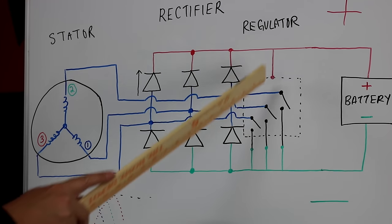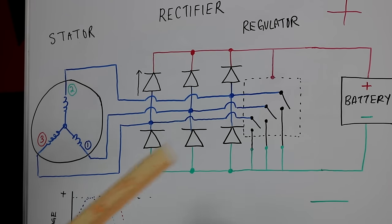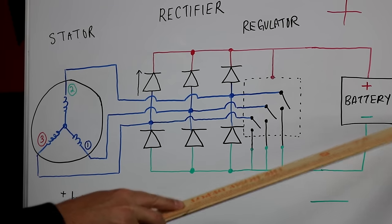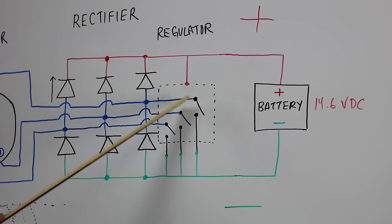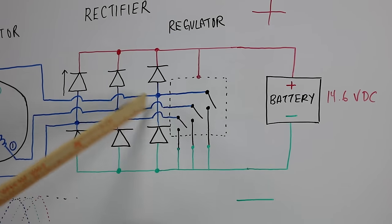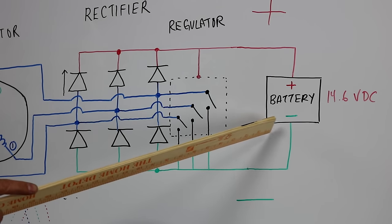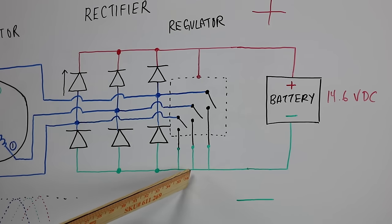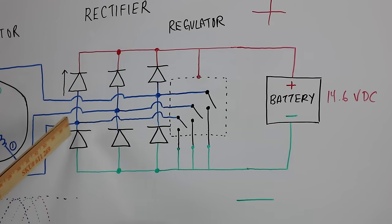The regulator is a separate piece of electronics on the circuit board inside that monitors battery voltage. When the battery voltage goes higher than the regulation point — generally 14.6 volts — the regulator circuit fires shunt switches that momentarily connect the stator coils to ground, bleeding off stator current to ground. By dissipating that current as heat — which is why these regulators have heat sink fins — it prevents the battery from overcharging and keeps the voltage where it should be.